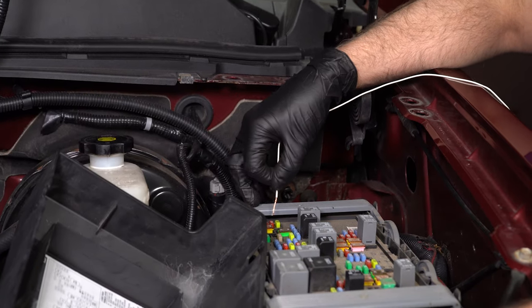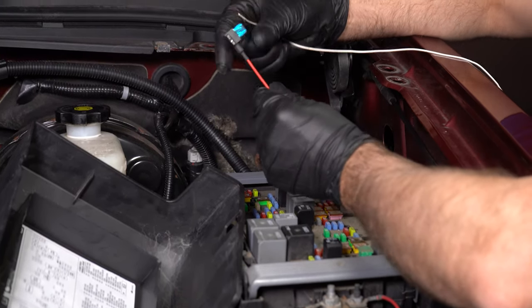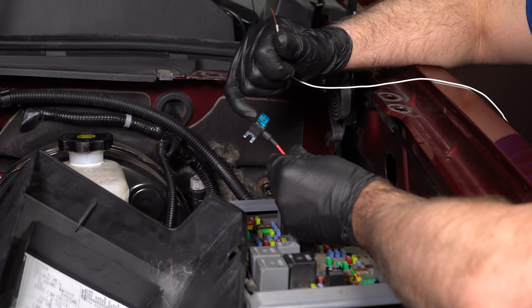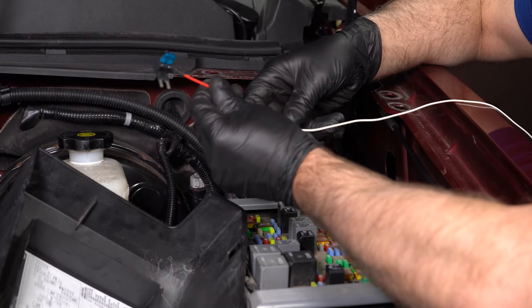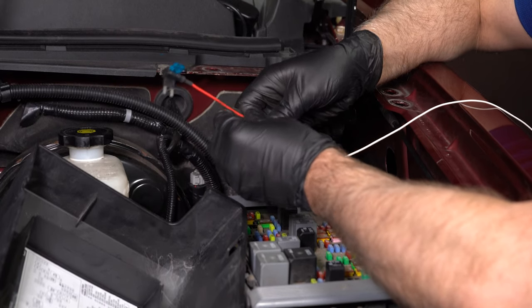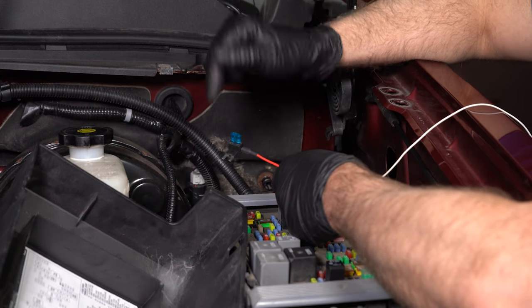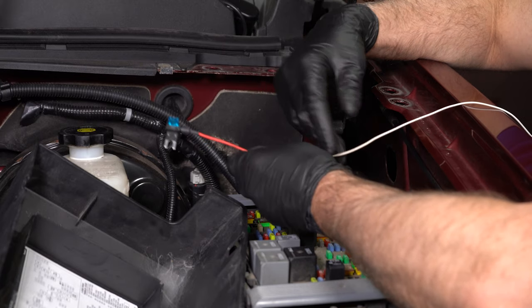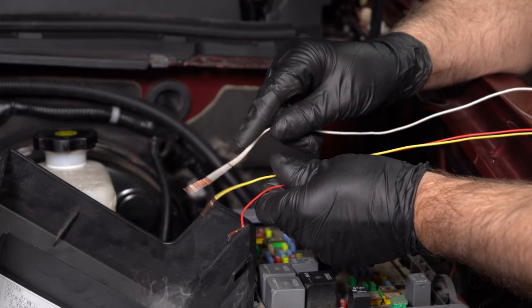How we're going to do that — that fuse is right here. We're going to use one of these piggyback connectors. We're going to pull the fuse out, put the fuse right there. There's another fuse in here that we're going to splice in these two wires. So we'll get the power going to the original fuse for the backup lights, and then we're going to have power coming through here going to our mirrors for the spotlights. We know where the white wire is going to go.